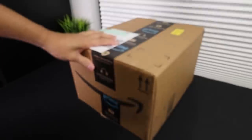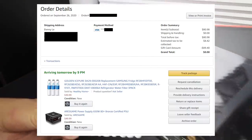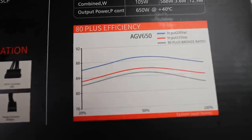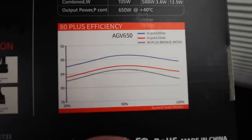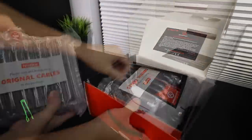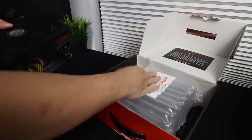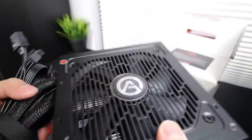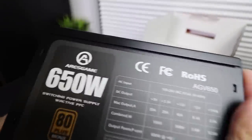The power supply is by far the sketchiest part of this build. I only had $50 budgeted out for it, and I could not find a unit from a reputable brand with at least 600W new or used, so I had to start looking at lesser known brands. I came across this Ares Gaming power supply on Amazon for $49.99 — it's 650W and bronze rated with decent Amazon reviews, which really doesn't count for anything since none of those reviews include the necessary equipment to properly test it. This was definitely a gamble, but according to the label the 12V rail is rated at 49 amps, which should be more than enough for the Ryzen 5 1600 AF and the RTX 3080 combined — assuming the rating is actually true. At this point I didn't really have a choice; this was the only unit I could find that would possibly work in the price range.